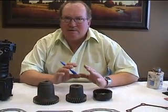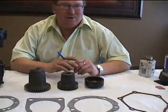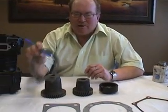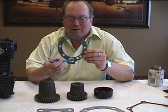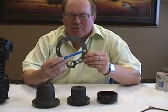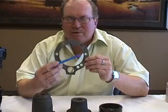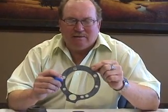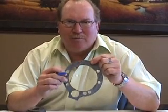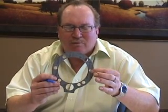Let's start with the simple things — the gaskets. Depending on the engine, the Cummins gasket, for example, has a quite large drain hole, but the oil hole is not so large. So when it comes to gaskets on the front of the air compressor, be careful that you don't load it up with silicone in a way that might restrict the oil flow.